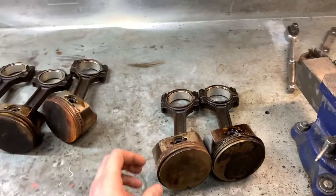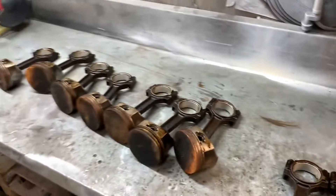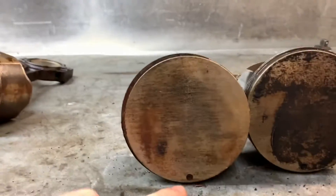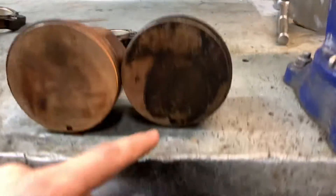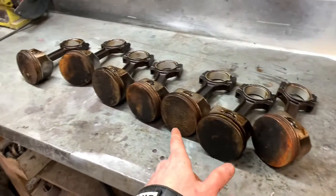This is commonly done. But which way do the pistons go on a rod? So this is my first time actually paying attention to this as I scrapped it. The dimple is up, the dot is down. And over here on the 5.3 the dimple is up, the dot is down. I checked and every one of these are the same thing.